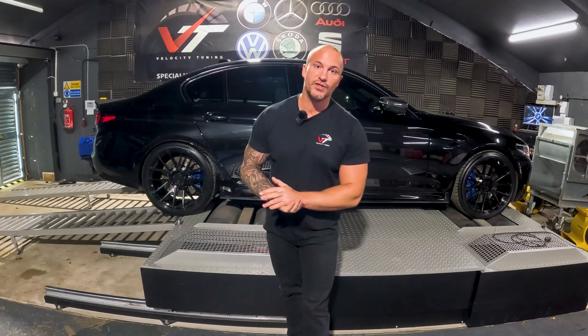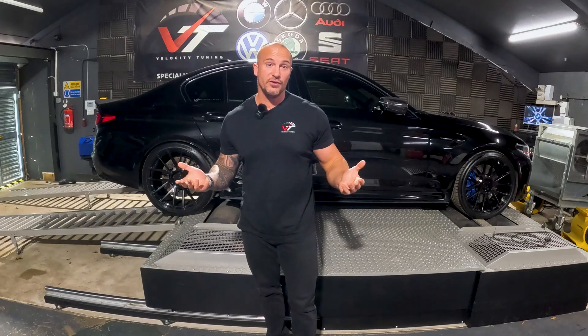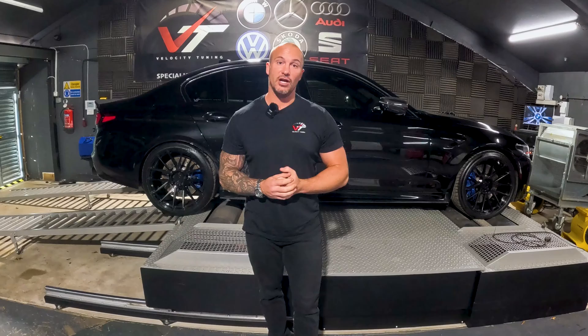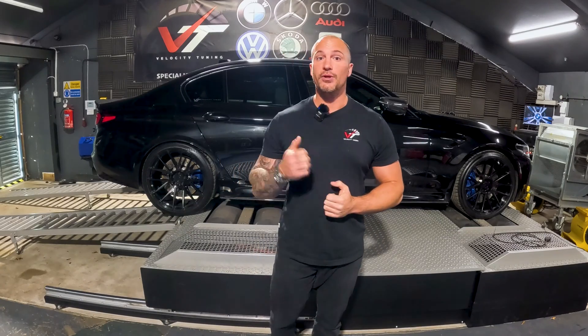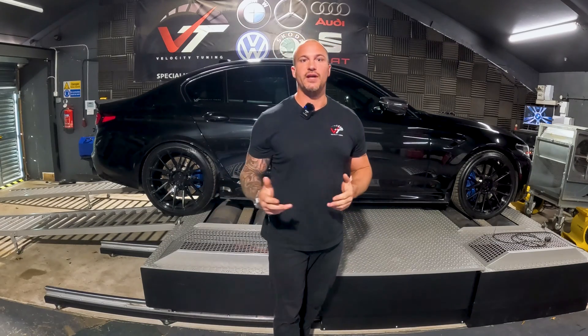If you're using a mobile phone, make sure you've got the Bluetooth turned off so you're just using the Wi-Fi. You could have something that's not even your fault happen — like maybe a phone call comes through halfway through the flash and it's enough to disturb it. So if possible, put the phone into airplane mode with just the Wi-Fi active, and that's going to ensure that nothing else is interrupting with the car whilst you're flashing.